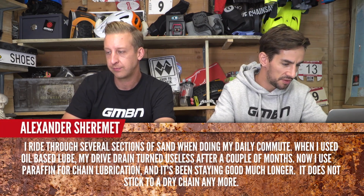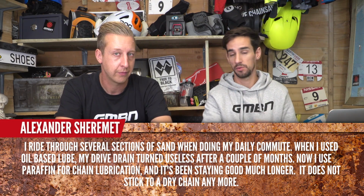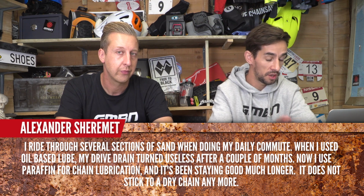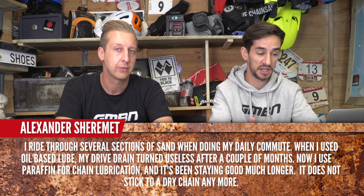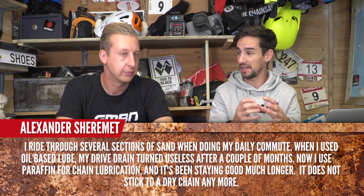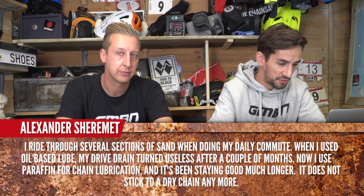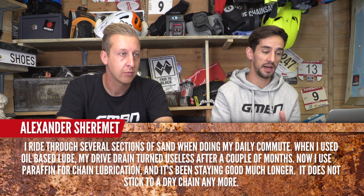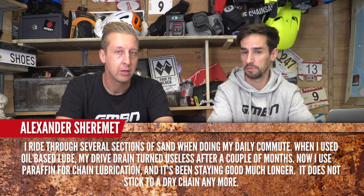Alexander Sheramet says he rides through several sections of sand on his daily commute, and when he used oil on his drivetrain, it was useless after a couple of months, because everything sticks to it and wears it down. Sure, yeah. So Alexander is recommending paraffin for chain lubrication because the sand doesn't stick to that and the chain lasts much longer, so that's a good bit of advice. That is good advice, yeah. I guess it's kind of similar to the wax based lubes that you can get.